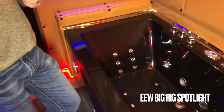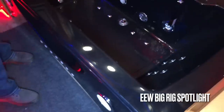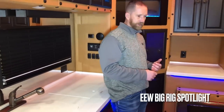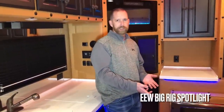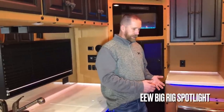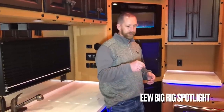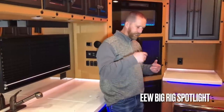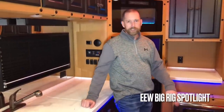One thing, this was not easy. There were a lot of complications with this. I can see. It's not just putting a hot tub in it and going. So my concern was, you have a 5-gallon electric water heater. You put that in here, you've got 70 gallons of water to fill this up. It's going to take forever for it to get hot. Exactly. So we went with an Aqua Source. It's basically an instant hot water heater. It uses antifreeze, almost like a heater core in a car, and heats it up. So that way it's instant hot water coming in; the water coming out of the tank or the hose goes through that and it comes in hot.